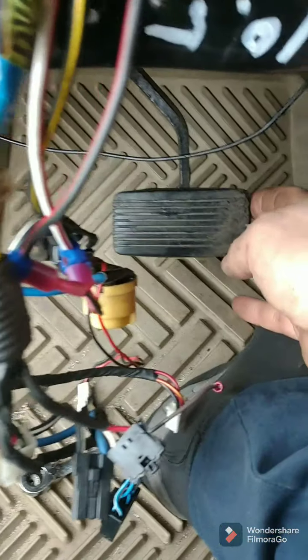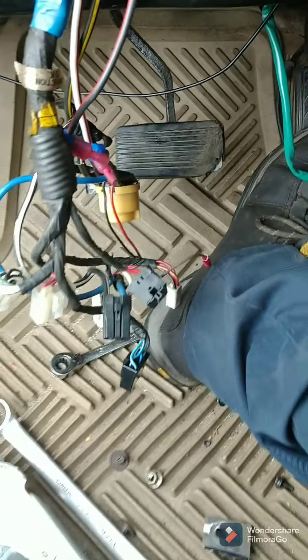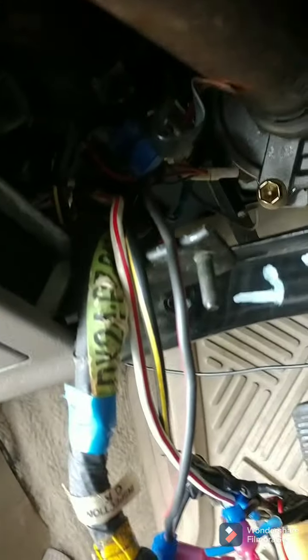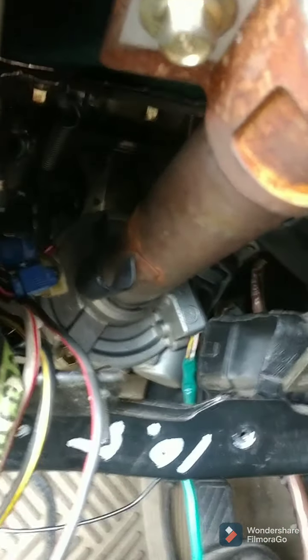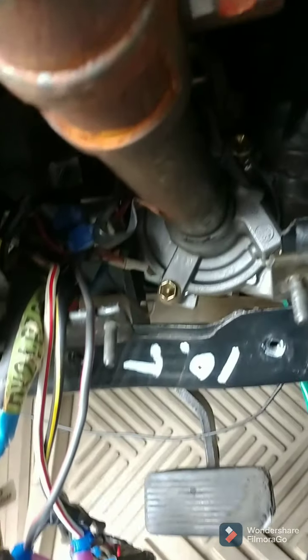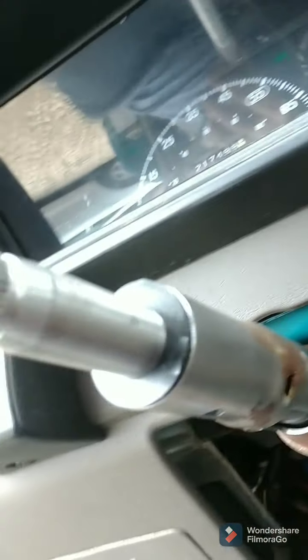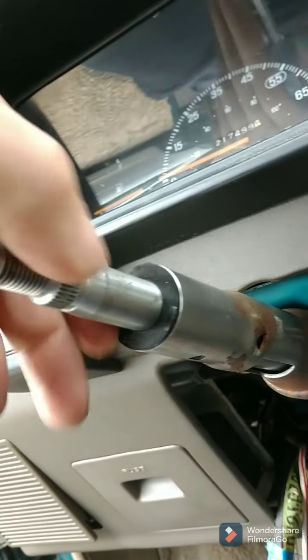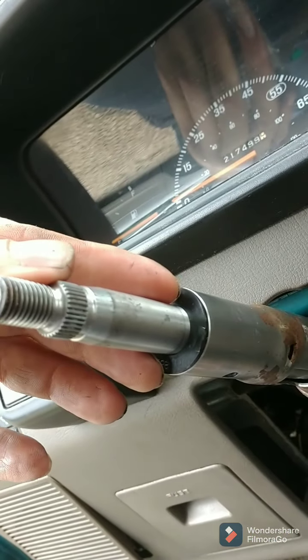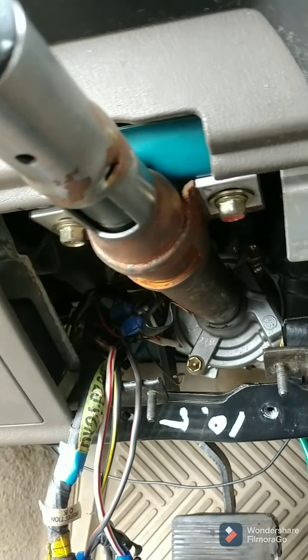And like I said, technically, you'd have to do a lot of work to get it off again, but it's something you can go out with. Right now with this bracket, it's really right on the money, and like I said, it gives an opportunity to collapse if need be. It's really not necessary to even bolt it. The two bolts on the outside are one thing, but it's in the spline shaft, and you see I can actually push it down. So when you tighten the steering wheel, I guess it's going to push up against this, and that will be okay. But that gives a little bit of room for going down.